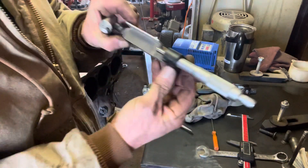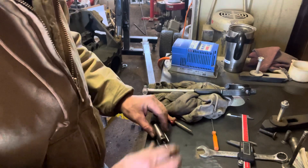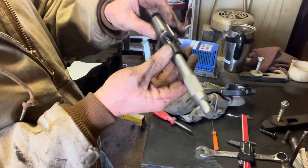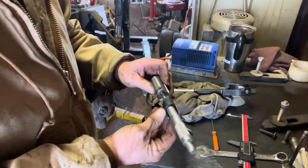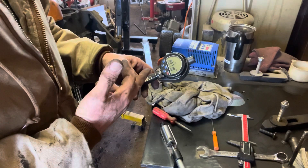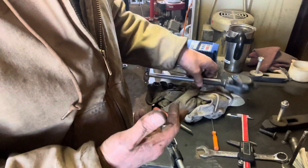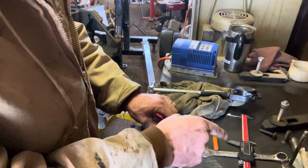You've got this little caliper here that's in millimeters and it tells you what you're seeing. There's a flat spot on there and you lay that up against the fence, then you dial this in. I've set up my cutter at 109.61mm. My piston mic'd out at 109.68mm, so I'll probably have to open that up just a little bit. The dial bore gauge shows the actual inside of the cylinder at 109.71mm. Of course your cylinder's got to be bigger than your piston, so I'm going to have to move this cutter back just a little bit to get closer to 109.71.